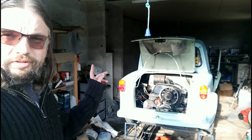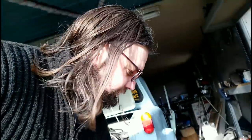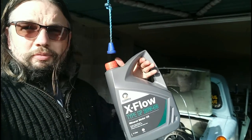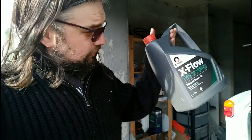It's actually a beautiful day. Just drained the oil out of Tuk — the thin oil. The oil pressure light was behaving a bit peculiar today. But we've got some 20-50 mineral oil to go in, which will hopefully be more suitable and help the engine feel a bit healthier. That was £12.99 from Charlie's, our local DIY store — certainly cheaper than the 20 quid Halfords wanted for their 20-50 oil.